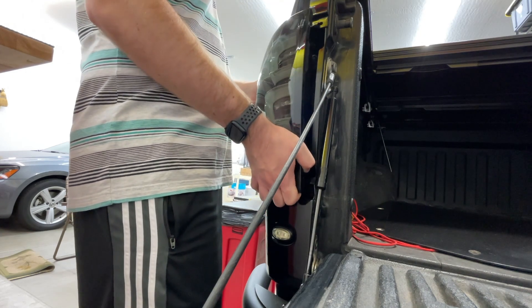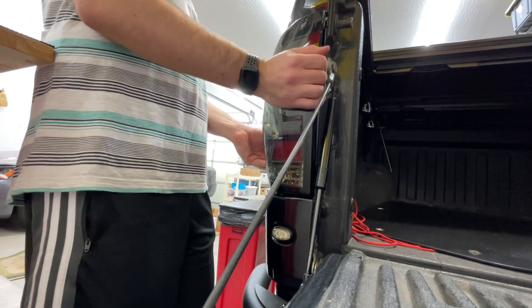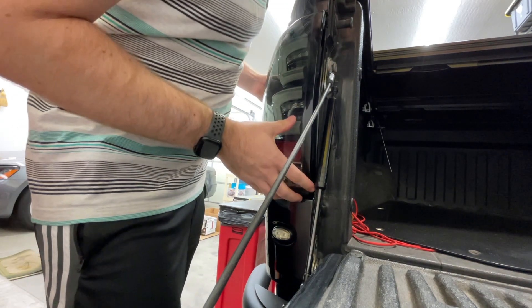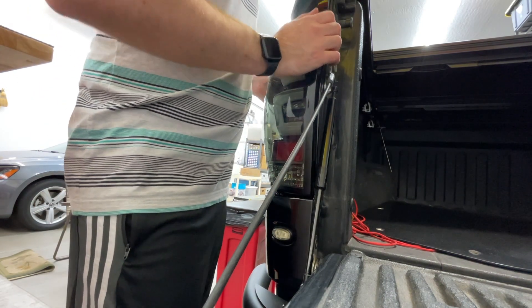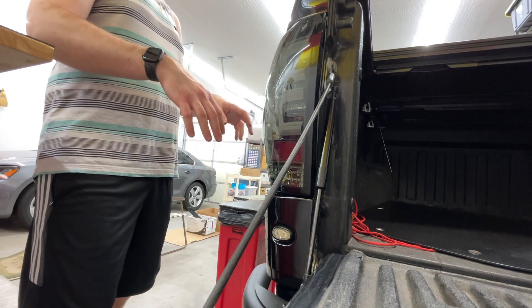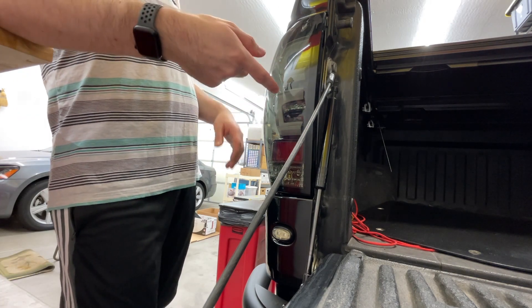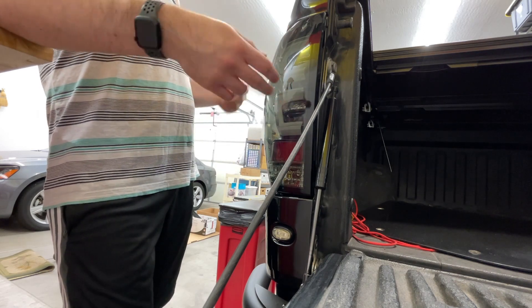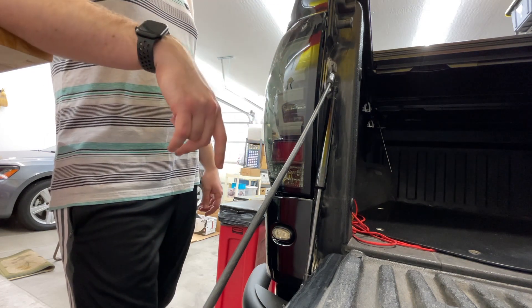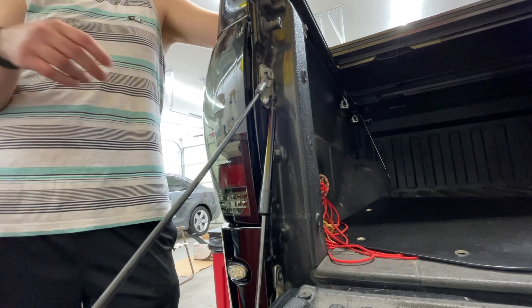The light should just slide into place. I don't necessarily want to pop it all the way in because I want to make sure the lights are plugged in correctly — that's popped somewhat into place. I'm going to cut the camera, make sure everything's working, and fix anything that's not. All we'd have to do is flip the way the socket's inserted 180 degrees from light to socket. I tested everything out and everything worked well, so I'm not going to pull it apart to double-check polarity — I'm assuming these are not polarity sensitive.